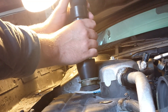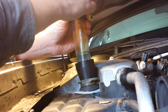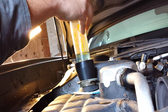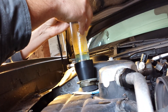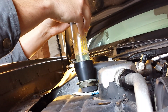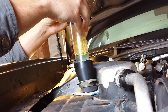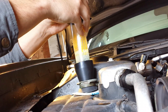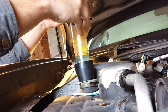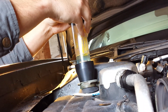It says to do it for about two minutes — squeeze the bulb and look for it to change colors. If it changes from that pretty blue color to yellow, then you have combustion gases in your engine. On a North Star, you'd expect that to cost a minimum of two thousand dollars to repair.